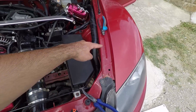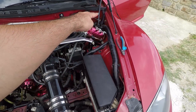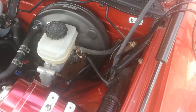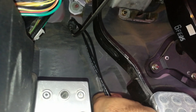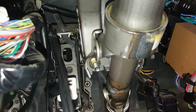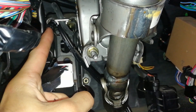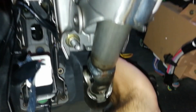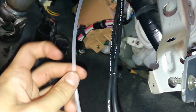The optimal way to run the wires will be all the way in the front and on the side, but mine was very short and I had to run it in the middle and then on the side. Make sure that you zip-tie the tubing containing the wires every 10 to 20 centimeters so that it's not loose in the engine bay. Next up, look up to the right corner of your engine bay and you should see this hole. If we take a look at it from the inside, we should be able to move it and see daylight. Run all three wires through it and get them inside the cabin. When done, remember to seal the hole on both sides with some transparent silicone to prevent water from entering the cabin. Zip-tie the wires together every 10 centimeters and run them upwards to this metal bracket. Here you will zip-tie them to it. Next, run them behind the steering shaft. Pull them up behind the metal bracket up to this big black group of wires. When there, zip-tie the three wires to that big one. This way, the wires will be out of the way of the steering rack when it's turning.